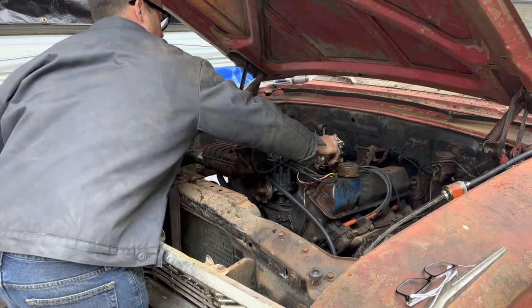I just cut this brake line. I wanted to show you, this is why you have to replace your brake hoses when they have been sitting. The inside swells up from age to the point where, if fluid gets through, it usually won't let it back out and your brakes will just lock up. So you have to replace the hoses if they've been sitting 20, 30 years like a car like this has. There's just no way around it.